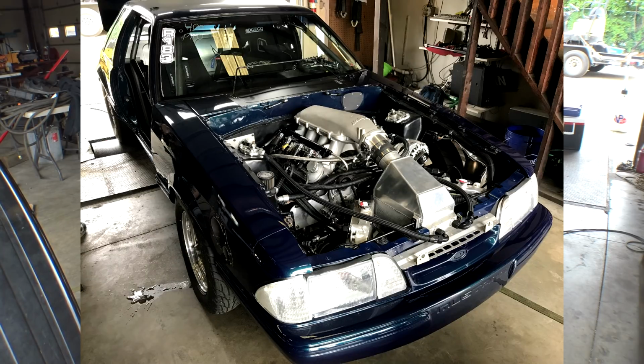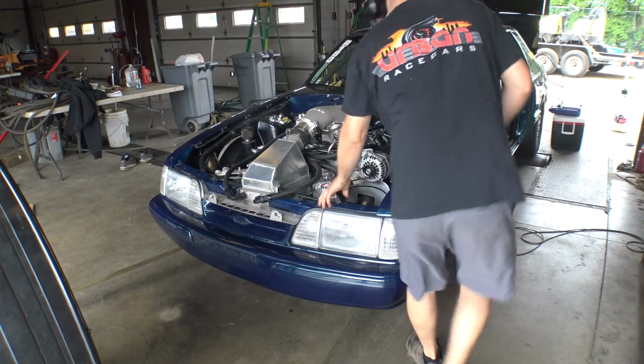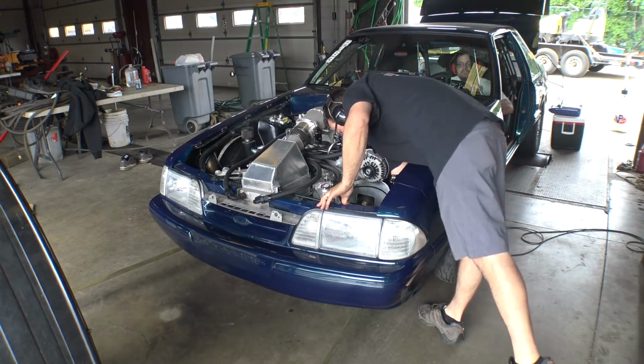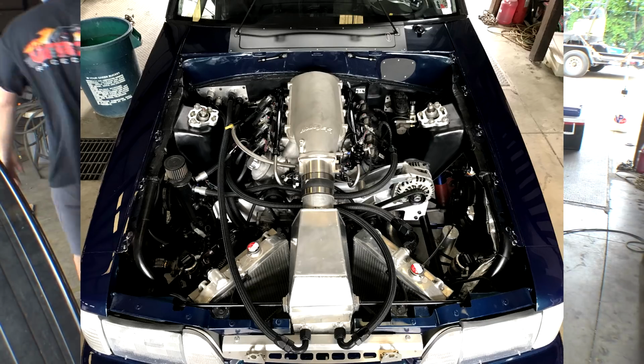This is the classic Whackshack notch that you all know and love. It's a 400-inch motor. It's half filled with concrete now. It has twin billet 78-75 turbos. He has a homemade air-to-water on it, Holley high ram, PTC converter, a Glide, a narrowed 8.8, all the usual suspects. It's running Holley EFI, and it has a single 4303 fuel pump for the testing, and it was on approximately E60 with a little bit of race gas mixed in there, bringing the percentage down.